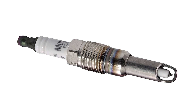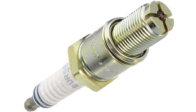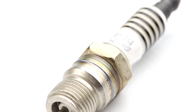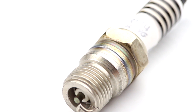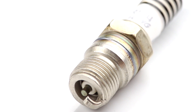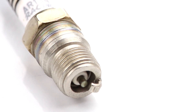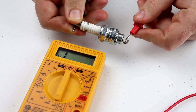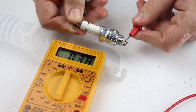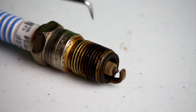However, sometimes factory original plugs have some of these unusual designs, such as this spark plug produced for rotary engines. Racing spark plugs have design differences that aren't ideal in non-racing engines — offset ground electrodes, much lower resistance, and different heat ranges are some of the noteworthy differences. We will get into installing and diagnosing spark plugs in another video. To continue learning about cars, follow Car Simplified on your preferred social media platform, and we will learn more in the next video. Thanks for watching.